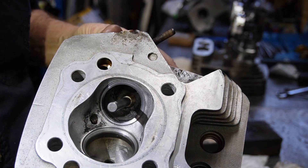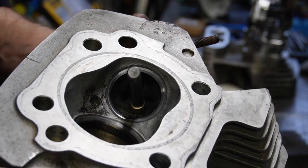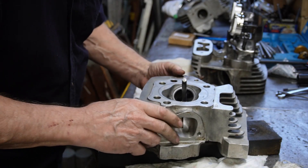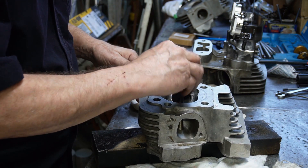I don't think that light really helps much — you can see it just as well without the light. But you can see where it's getting shiny all the way around there, so we are getting a seat cut in it, and we're not way, way out. Let's try a 60 at the bottom and see what's happening.